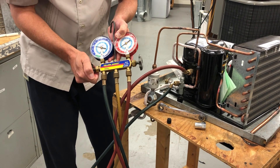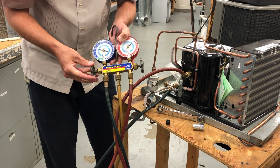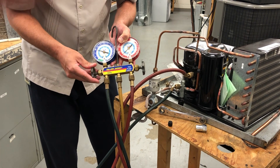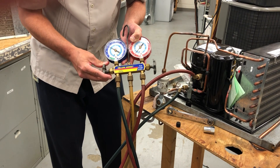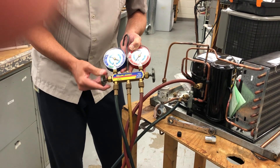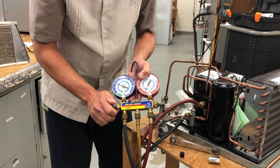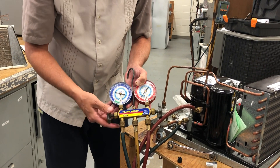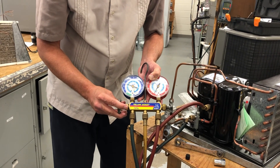You saw it go up a little bit. Once these both equalize, they're both the same. So if this one hits at about 20, this one should stop at about 20 — look at that, I'm still doing this with all that liquid. That would have been a couple ounces of refrigerant, and this thing only takes six, seven, eight ounces really. It's not that much. So when I'm disconnecting the gauge, I could lose half the charge that we just put in by just opening and closing the gauge hoses when I disconnect it.